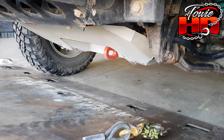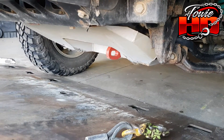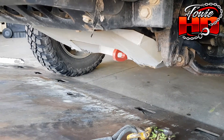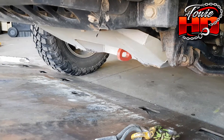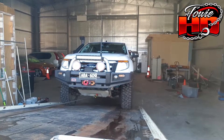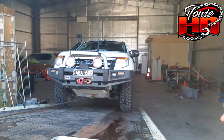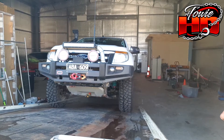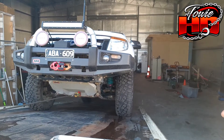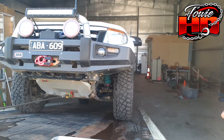As you can see, I've got my Ranger ready to go and I've got two tow points on that one. One is the factory tow point and the other one is a load-rated tow point which is towards the centre of the car. While I'm winching up on the load-rated tow point at the centre of the car, it's going up smooth, it's going up nice and straight. The winch cable has fallen on the barrel quite nicely and I'm not having any issues at all.